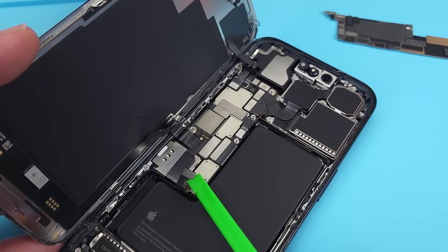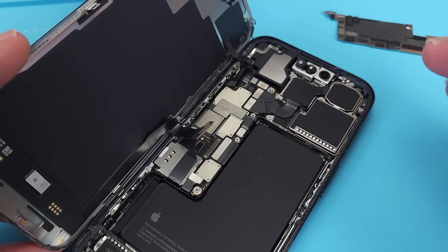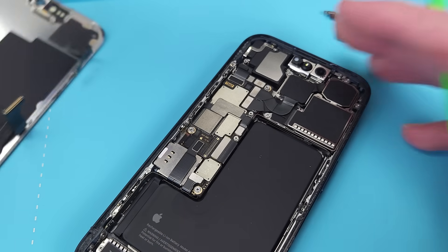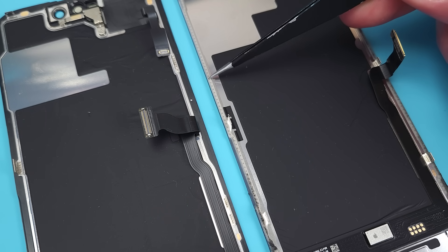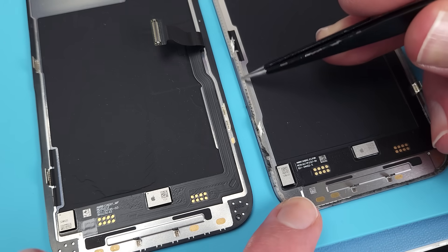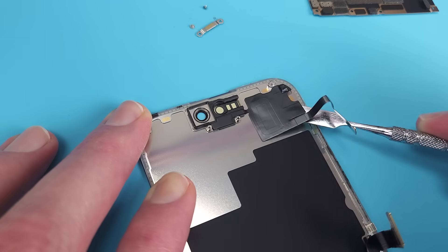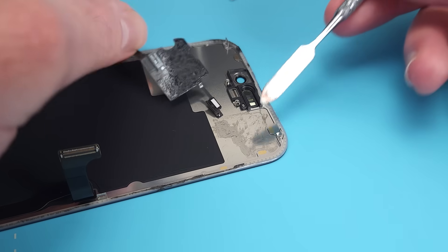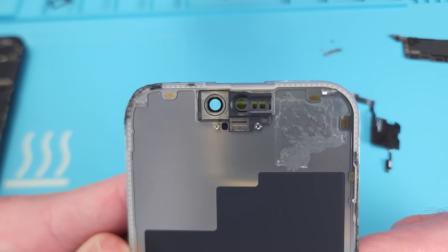I'll disconnect the battery first, before the single screen flex cable and the light sensor. The 15 Pro has a new thinner plastic frame around the screen border, which I'm guessing has a higher surface energy to make the display's thinner bezels possible. The only component on the screen assembly is the proximity sensor, as the dynamic island is just part of the display, with cutouts for the camera and sensors.